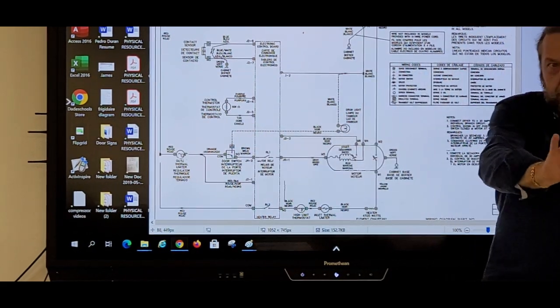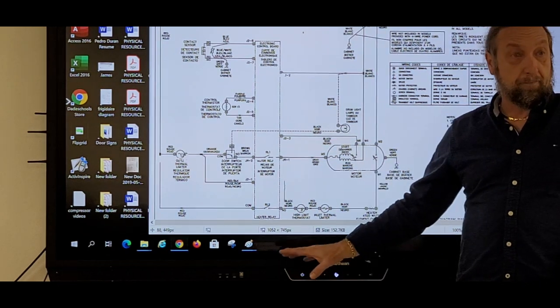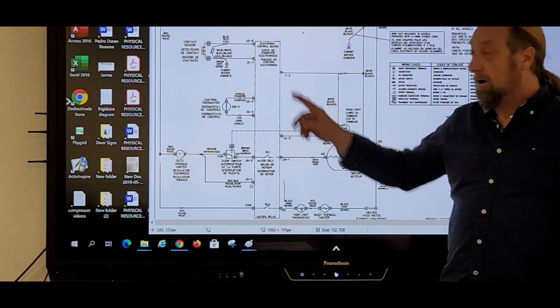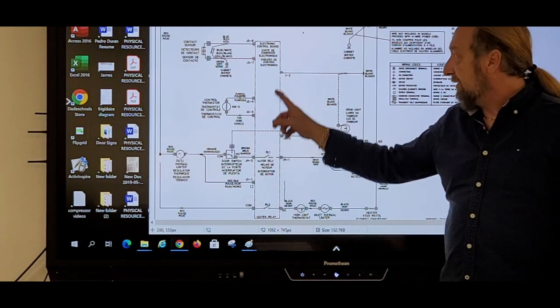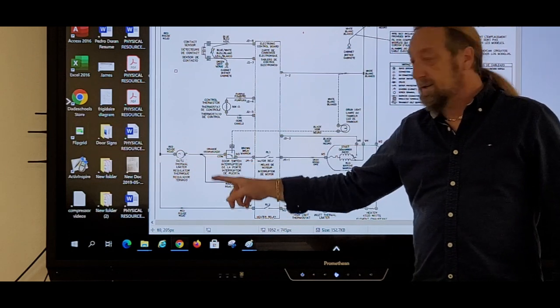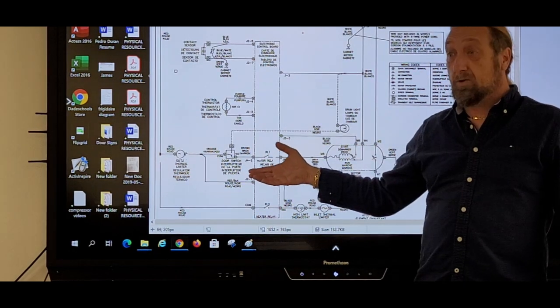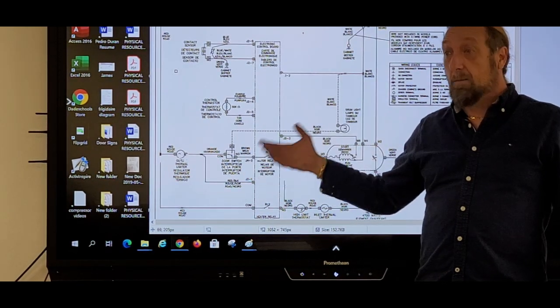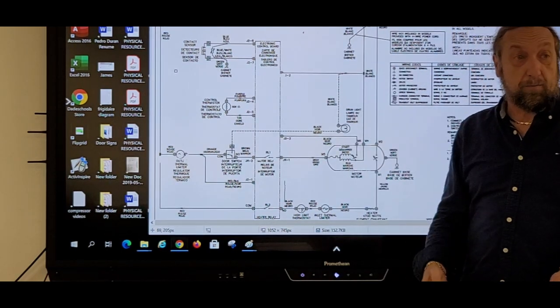No. Let's rephrase this, okay? Motor don't work. We tested here, our board lights up all day. I tested here and here, and I don't have voltage. So I know I got voltage here on this side of the door switch. I know I don't have voltage there. I know my door switch is not sending voltage. Okay? But my dryer is not running. I want to see the dryer run before I leave.